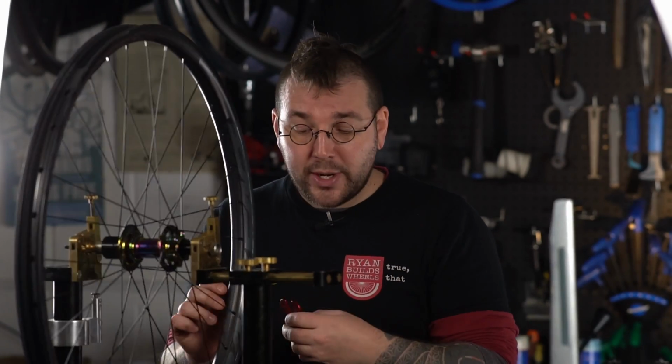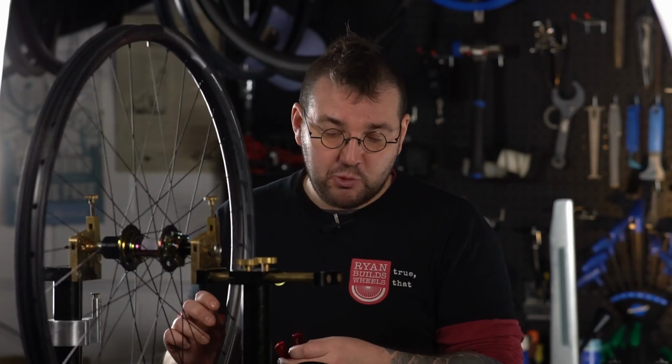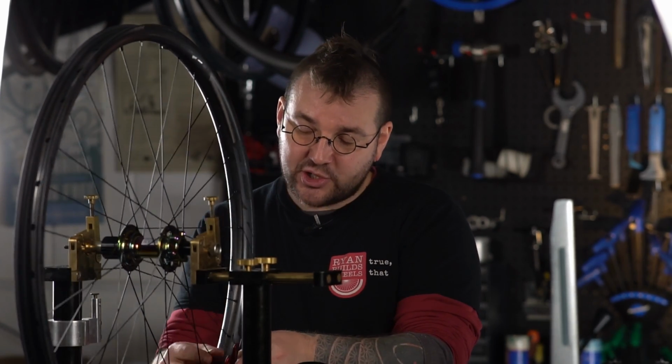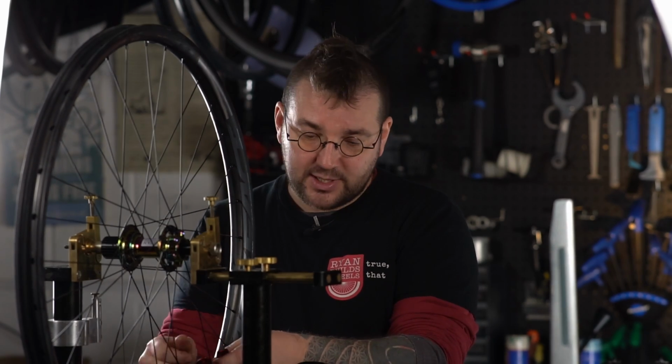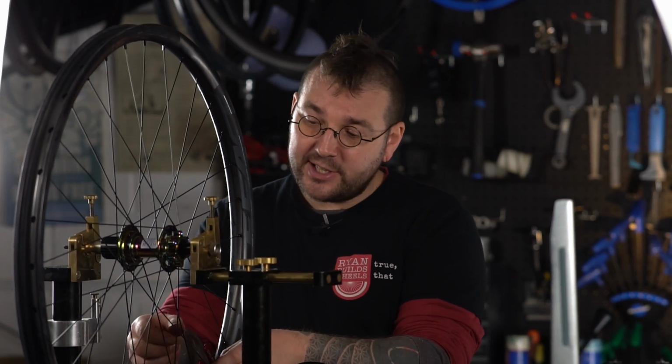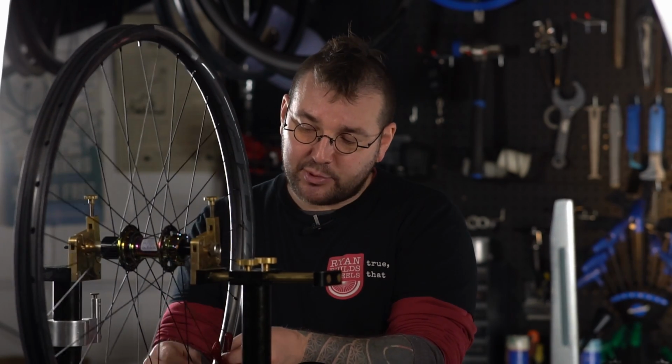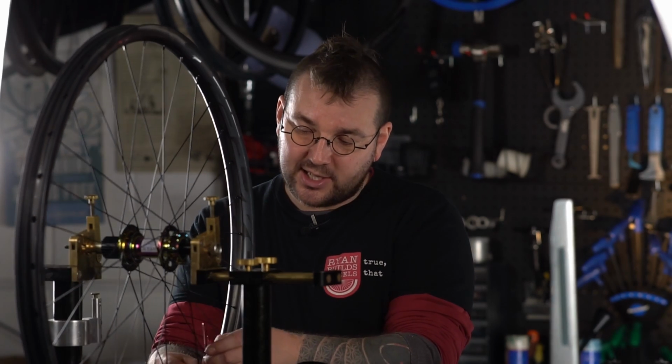Right now, all we're going to do is sketch a roughly straight shape in our wheel. Keep on working your way around, adding tension in the direction that you need the rim to travel, taking tension off the other side. Naturally, if you find any spokes that by feel are super tight or super loose compared to the others, you can try correcting that now. But generally speaking, I find this taking-it-steady process is a great way to start learning.